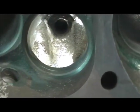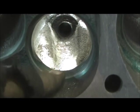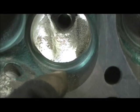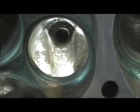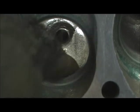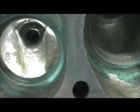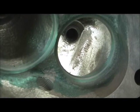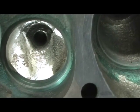Now when we switch over here and go to this one, look at that fillet. You can see the silver line — remember where I scribed it, it's way up from there, and then a bunch up there. So pretty much the gray line shows it's got to do a hump and roll to get out, instead of being able to pick off the 45 and then the 70 and then roll off. It's got a big fillet radius and that's just not what you want. No fillet versus a bunch of fillet — that's why we go back in there and do it.